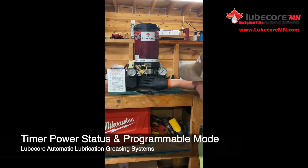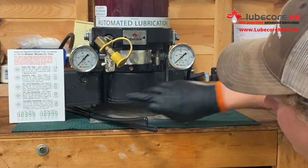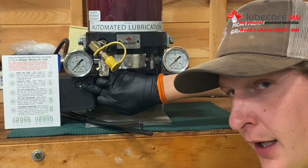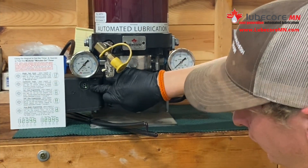Now as you'll see, you'll have a blinking light here. These pumps are wired into constant power, keyable accessory, and a ground. You'll see a solid blinking light when the machine is hooked up and you cannot program it then. Once the key is turned and you get this constant blinking light, you can program it.